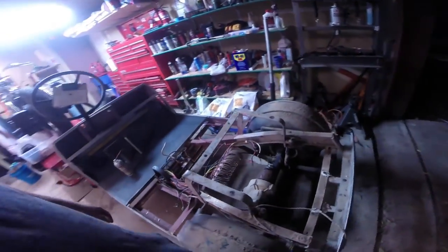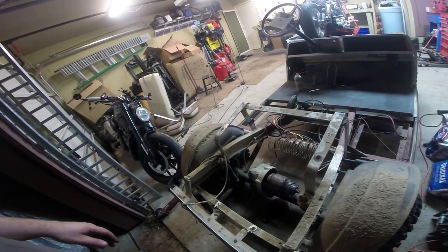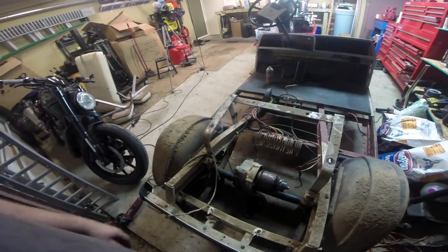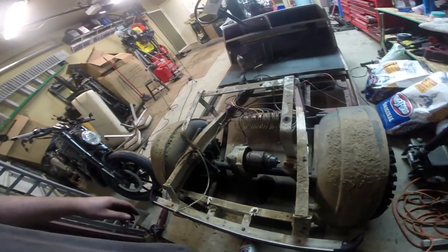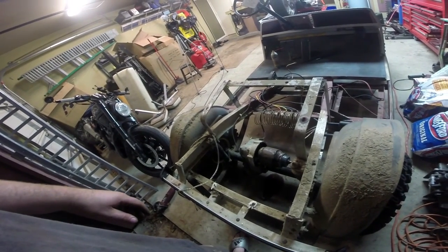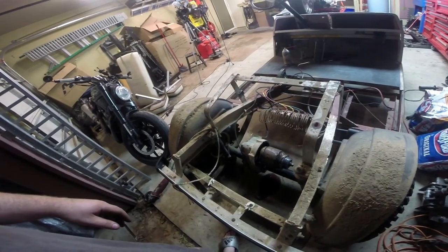This is as far as I made it tonight. I'm beat with time and rust. It was exciting because it's an all-aluminum frame so I thought we're not going to have any rust — but lo and behold, the rotor part of the engine has all the brushes trashed. This whole engine is basically just scrap at this point. And it actually rust-welded itself to the input shaft, so I put some penetrating chemistry in there and I'm going to get a MAP torch tomorrow to heat it up and work that thing off, because it's got to come out.